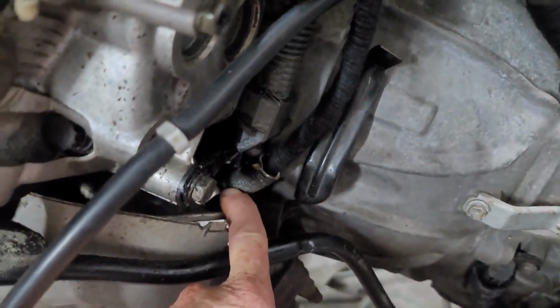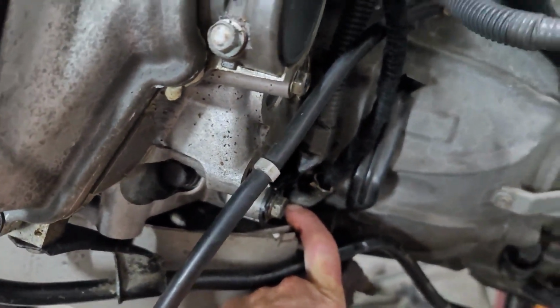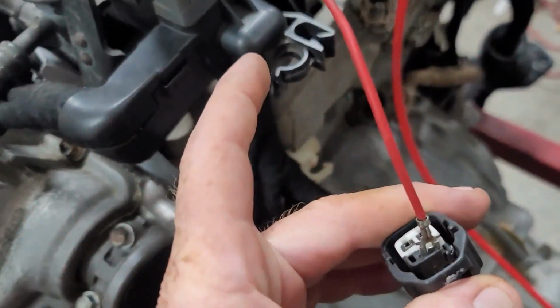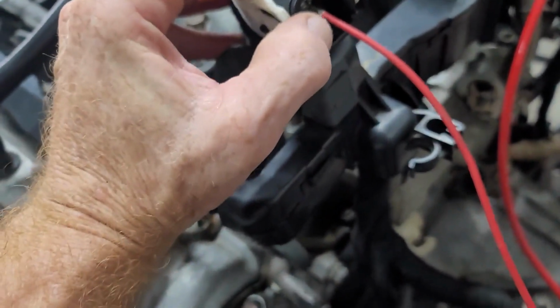Coming down here you have your left hand O2 sensor. That is required for the management to get the fuel-air ratios correct. I've put in a jumper cable here. I've got a 3-pin on my test engine. You've got the big SC connector. In here you've got your starter solenoid. That's why I've got this, just to be able to test run.